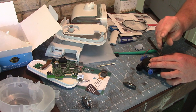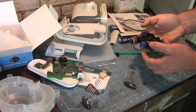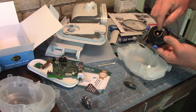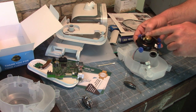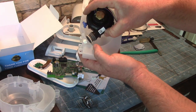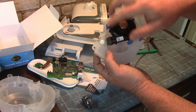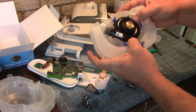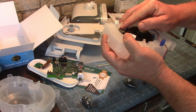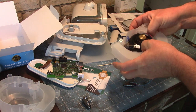I'm going to get these screws in. Let's go ahead and put this rubber back on with that seated all the way down. We will take the air chamber — the new one — and the opening goes down, this part goes up. What we've got to really focus on is seating the three little rubber seats, and also this part has a little groove that goes in. We'll push evenly all the way around, making sure that thing is seated fully. You can look into the intake to make sure it's lined up. And we're in.